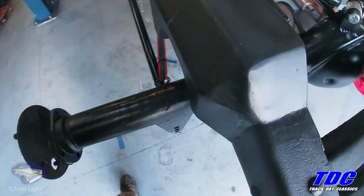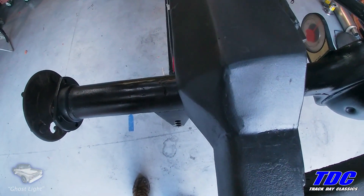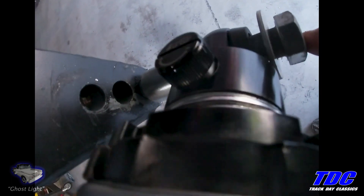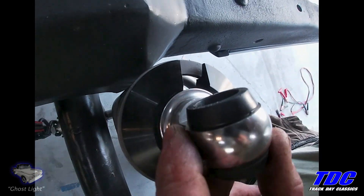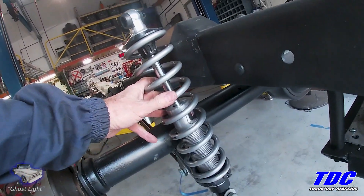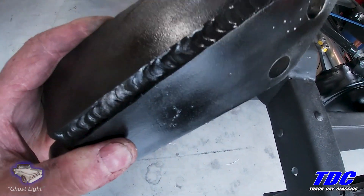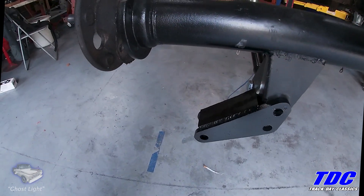When I first braced these in, I thought more is better, right? I remember saying before that there's no downside — well, actually there is. So here we are putting in the supplied hardware with the shock. There is a downside — the shock is pretty tall and it's going to be up in the bed. So I had an idea: I had some half-inch and some quarter-inch cold rolled plate, and I ended up with this bracket. It goes on something like that and gives us the length we want for our shock.